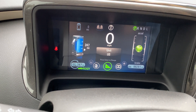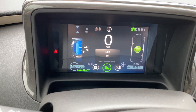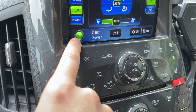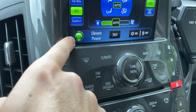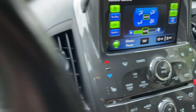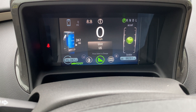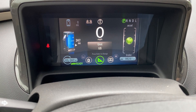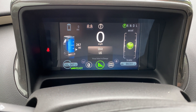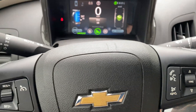It's still running the gas engine even after switching back to normal mode. That's because after switching from mountain mode, it will keep running the gas engine until it heats up and stops using electric power for the climate system. This can be useful in winter — you can switch to mountain mode and immediately switch back, and the gas engine will run until it heats up and warms your car. That's a little trick I found out about this car. Please subscribe to this channel, see you in the next videos, bye!